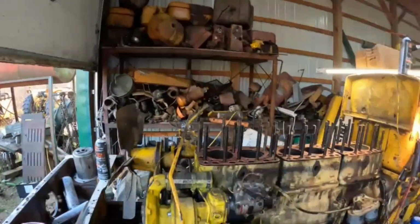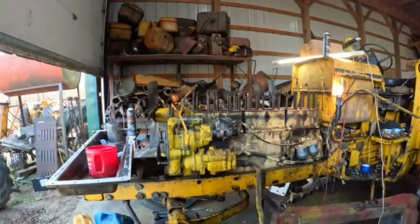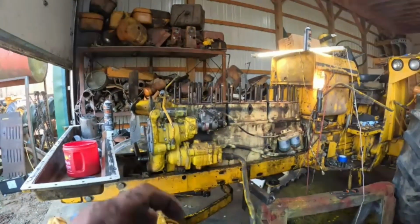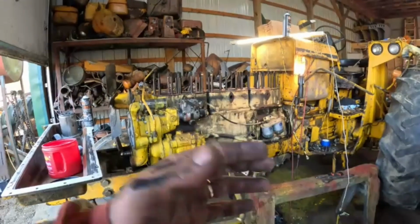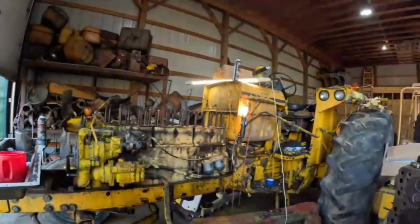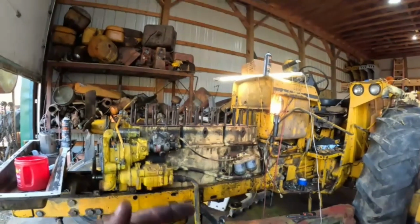And I've also got number one cylinder's top dead center at the moment. That'll ease things up. I'm going to leave the oil pan off too, so I can know when whatever cylinder is all the way up when we're setting the valves, lash or whatever you call it. So yeah, a little bit of thinking ahead saves you guessing.